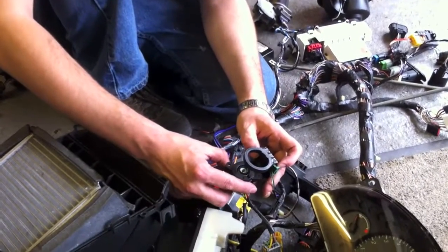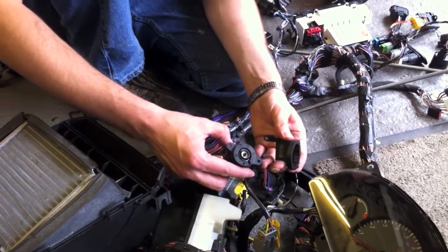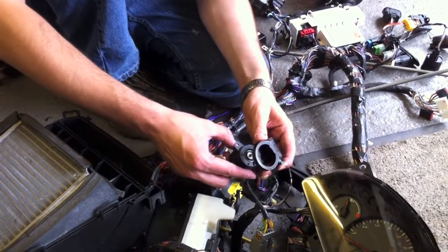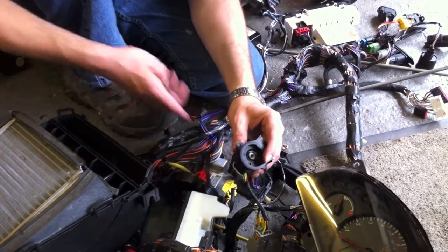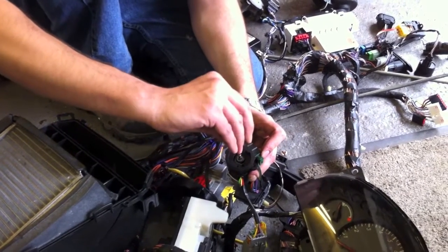Hello, Palo. So Palo's going to fire up the engine for us. On the left here is the ignition slot, and on the right is a coil that is powering the RFID tag for the immobiliser. They need to be put in in a specific order so that the immobiliser works correctly and the ECU is happy that it's the correct key.